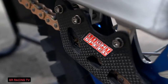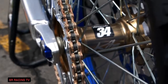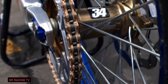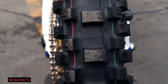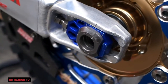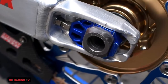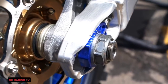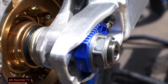For the rear chain block we use a Lightspeed carbon piece with a production guide inside. The chain is EK chain with a Vortex rear sprocket held on by titanium bolts. Kite rear hub in the rear, Dunlop spec rear tire, and an Excel rim. The rear axle is titanium and it's mounted with Zeta blocks. Right now we're running the axle kind of in the middle of the adjustment range — it keeps him feeling happy both in the whoops and in the turns. He rarely changes that.